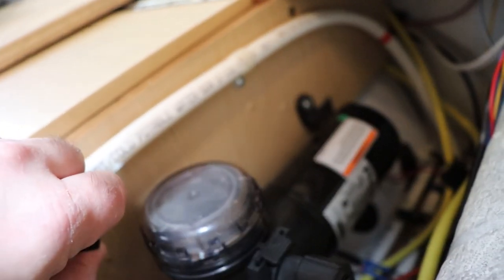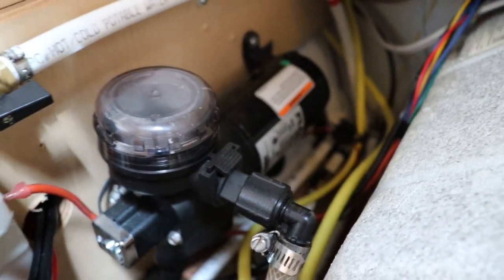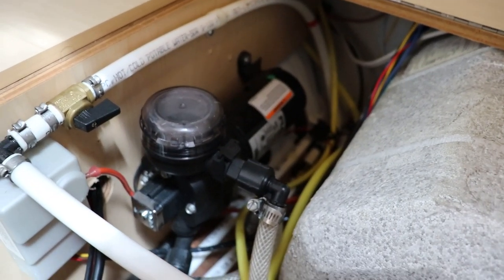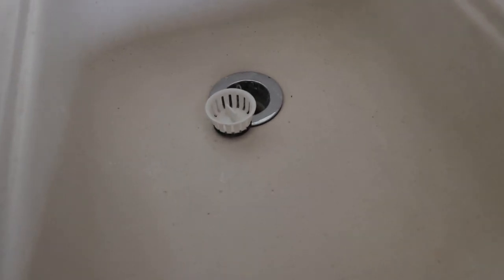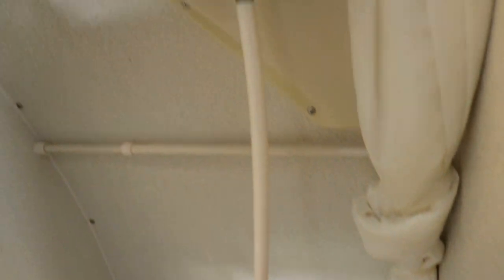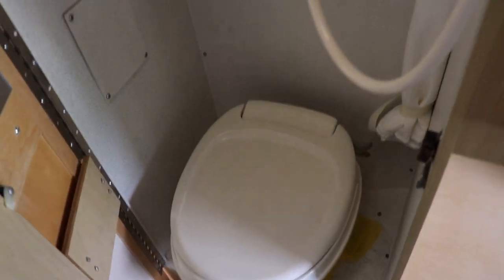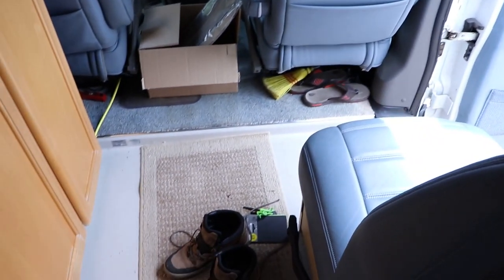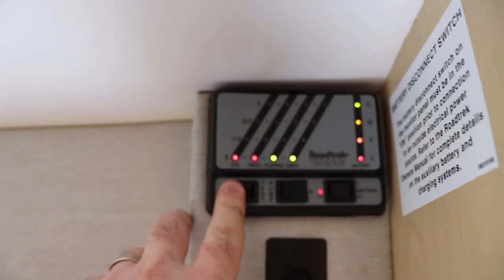I'm going to open these up now because I want water to flow pretty much everywhere at this point while we're sanitizing things. We're going to be running the sink on hot and cold, and the shower — might as well be complete so we know everything works before we go. We'll run some water through the toilet too. We're not going to drain the gray and black water tanks after this — they've got antifreeze in them and they'll be fine. So you can go to the panel and check your levels. Right now you can see I'm empty on all levels.